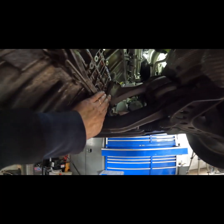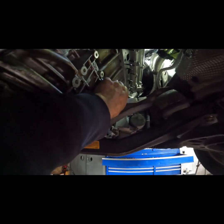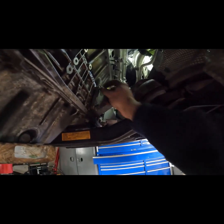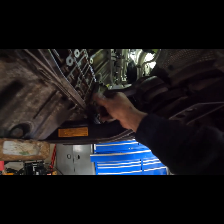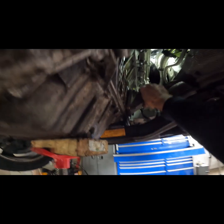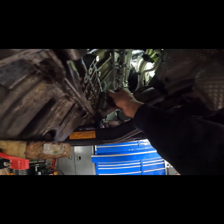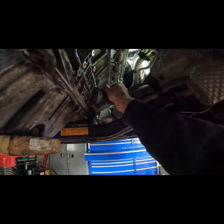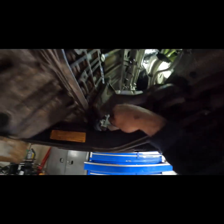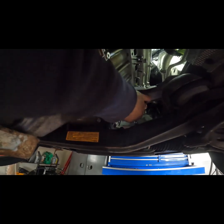Here's a quick tip: bring this up and loosen these up. You should be able to turn them all by hand. If they're tight, you need to apply some more upward pressure on the engine because you don't want any tension on these bolts. They should all come out basically by hand because all of the weight should be on your support. See how this is all nice and floating — so when I put this back in, you won't cross-thread anything.